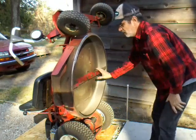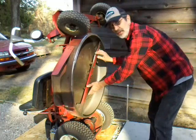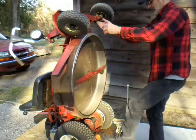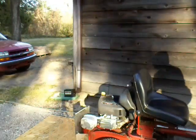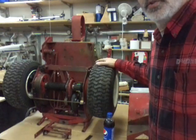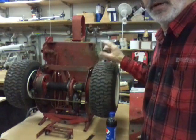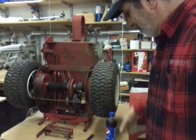You could also check what the bearings are like in here - I don't have any wiggle at all. Check the bearings on the spindle and see how they turn. This isn't going to turn very free because there's a brake in there that holds it from turning, so don't let that bother you. If this turns really hard, that's the issue. Now let's go inside. This is my old 28-inch that I had for about 25-27 years. I rebuilt the whole drivetrain about 20 years ago and it was still working pretty good, but it's got some issues now.